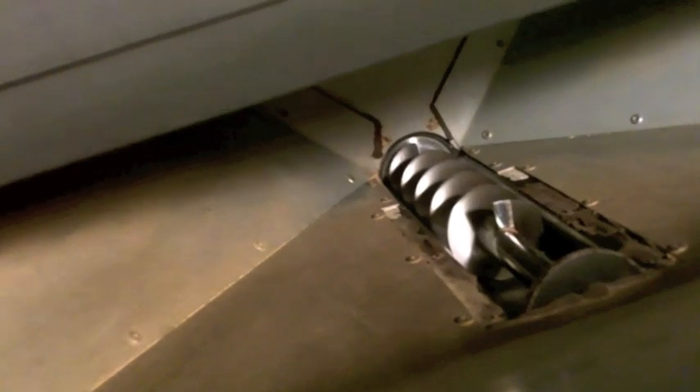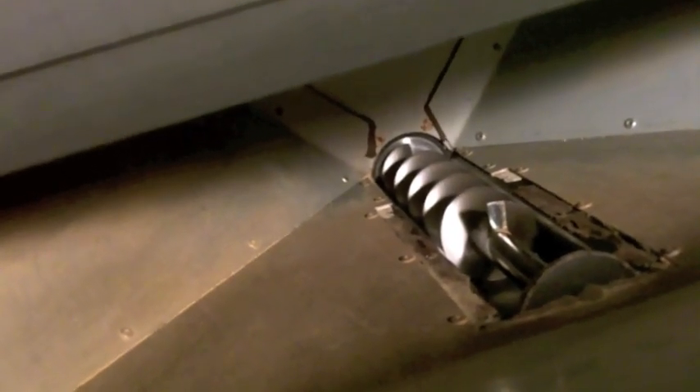It has an auger cover and a pretty shiny auger. I just vacuumed it out — it was jammed up with dust. So if you use a pellet stove, be sure you use some kind of strainer and don't put a bunch of sawdust down there because it jams up your auger. This auger has a friction plate clutch on it, so it won't break if the auger gets jammed — it just stops.